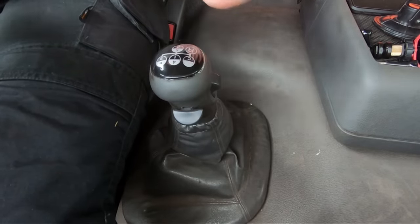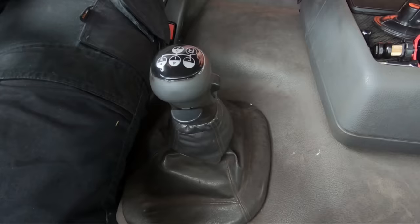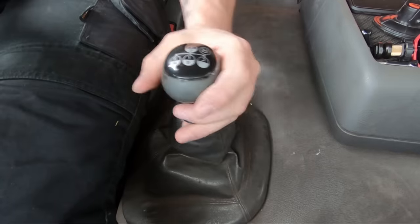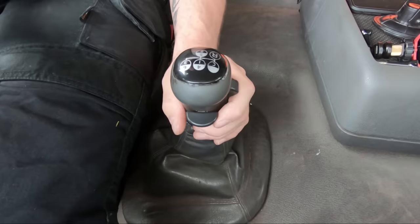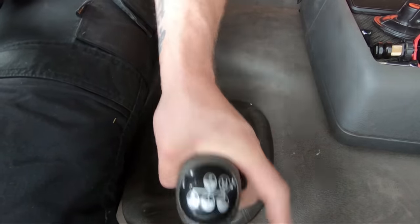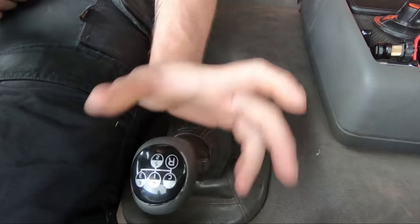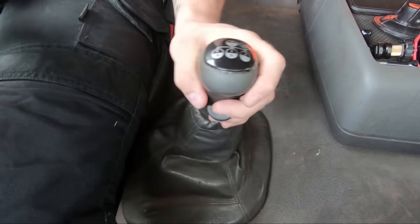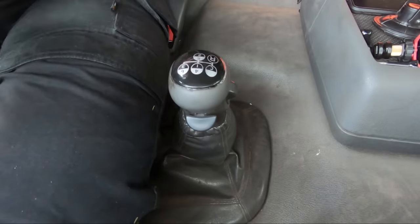When we're empty we'll do second, third, up into fourth, fifth, sixth, and then split to the top when we're in sixth — we're not going to touch the splitter below that while empty. If you want to really simplify it — it might cause a bit of extra clutch wear — you can set off in fourth high and go fourth, fifth, sixth, split it to sixth top and you're at cruising speed at 56 miles an hour. But for clutch wear, we're going to start off in second.